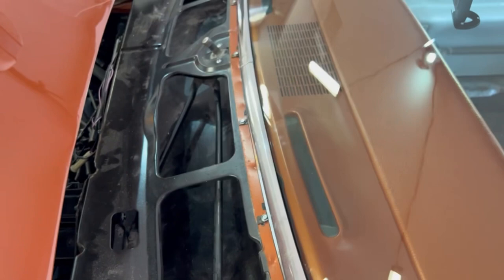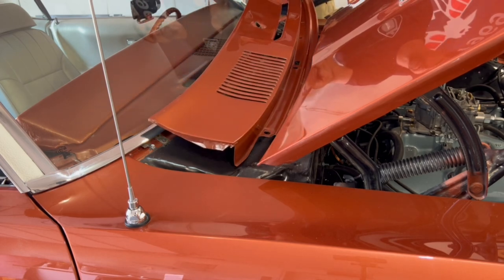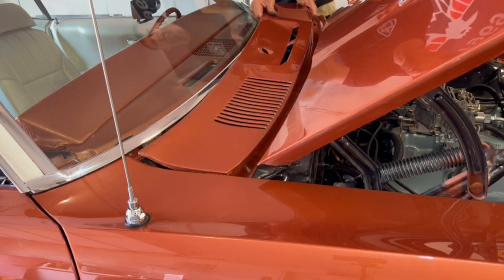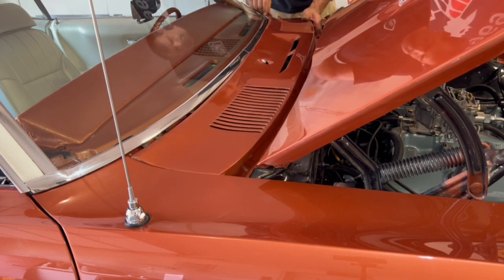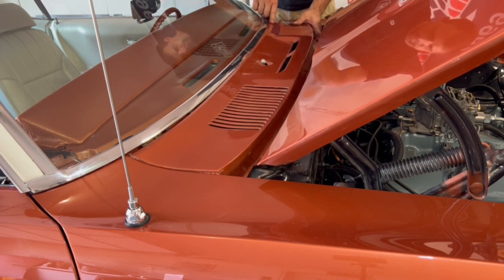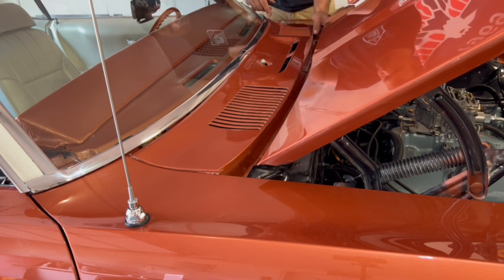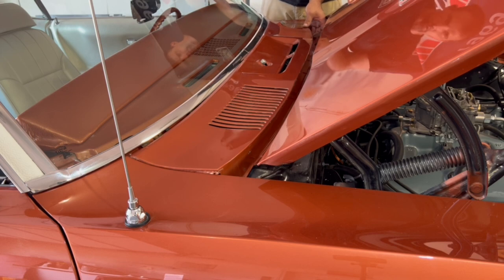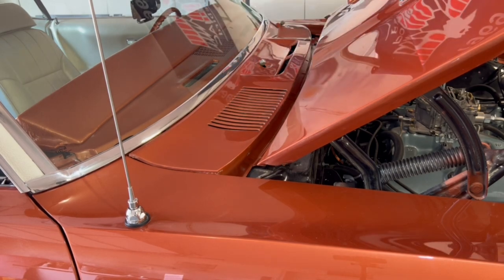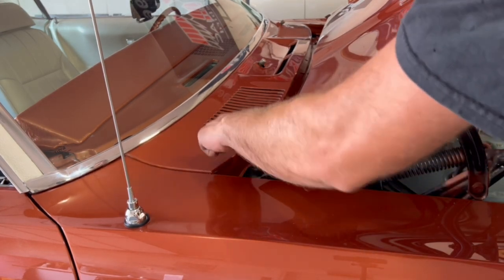Tape is cheap, paint is not — be careful putting the cowling in here, there's so much stuff you could run into. The cowling actually has trim clips underneath the window trim that it slides into, so you push it down and then slide it back into place. I've got it in place now — there are four or five bolts that pass in here to the firewall. It kind of tucks underneath and slides into place, then secure it down.